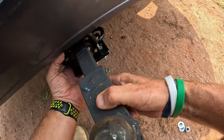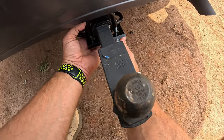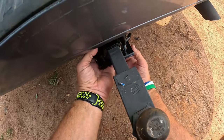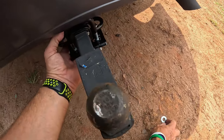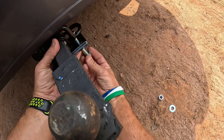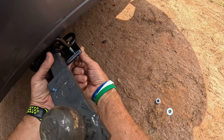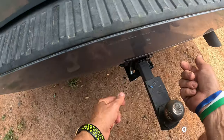Because what it does — you hear this? That's so annoying when I hit things. I can hit just little bumps and I'll hear that noise constantly going. This is going to silence that, in theory anyway. So let's go ahead and put that on. I forgot to put my washer — you got a lock washer, you got a washer, and then you got a lock washer, and then you got a nut. That's going to go right there. I will show you a close-up of this when I start tightening it down.